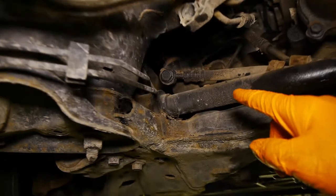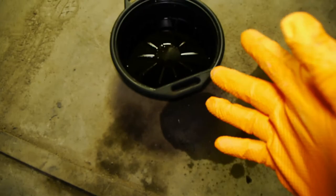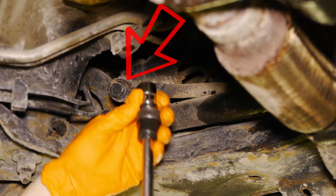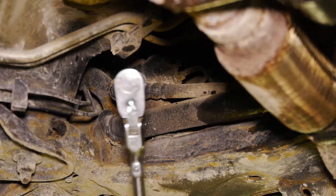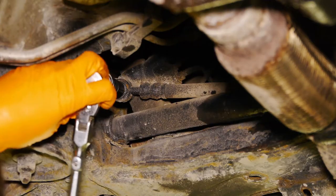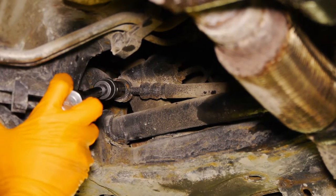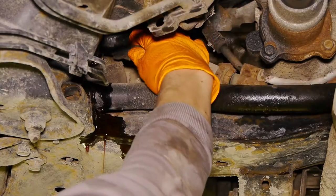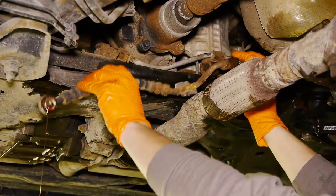When I'm going to disconnect the hose from the steering rack, the fluid will come out. So I'll put a drain pan underneath where it will be leaking. This bolt comes undone fairly simple — get a 3/8 extension, put a swivel on it with a 17mm socket attached to a 3/8 ratchet. You can put it on pretty straight and it comes off no problem. You can already take it out of the brackets to make it drain better.